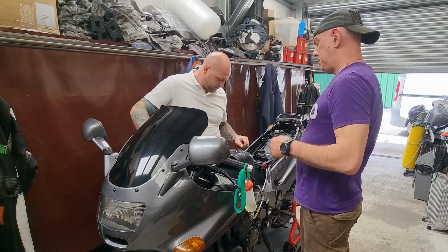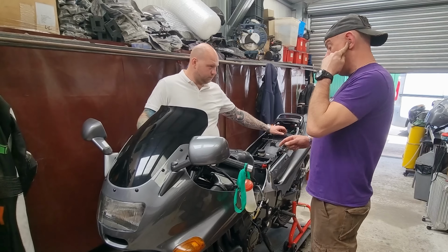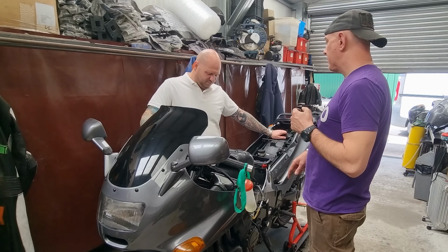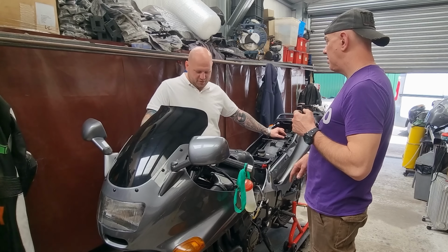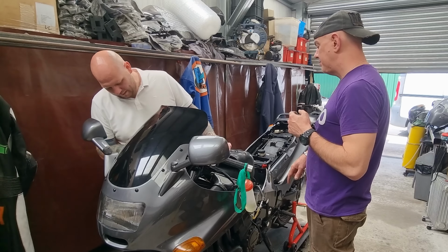Right, so stupid question. It's had, what, 421 miles on it. I was going to wait till 500 before we tighten down, have the lid off it, tighten the head up again, dump all the oil and all that lot. If it's got loose, could that have anything to do with it? You'll probably hear it before anything else. Could be.